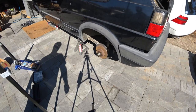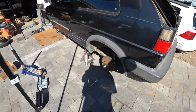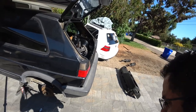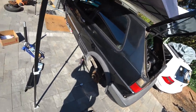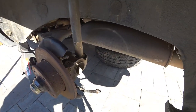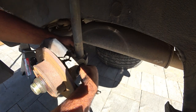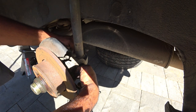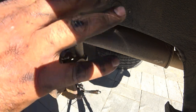Then on the bottom is where you're going to need the jack. Now down below — let me get you guys close, give me a second here, get my tripod all adjusted down for you guys. Alright, so down below there's a 17 back here and a 17 on the inside. So you're going to need that wrench again to hold that down, then grab this and break it loose. Then put a jack underneath here to keep tension on it so nothing just drops down.